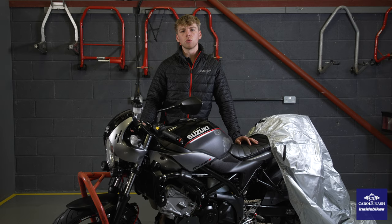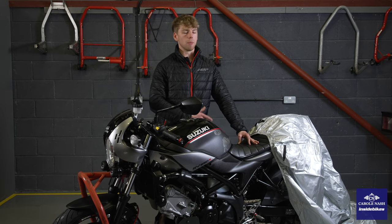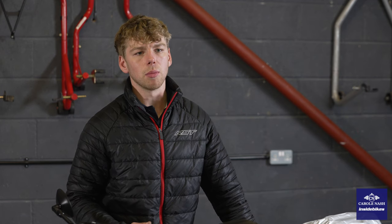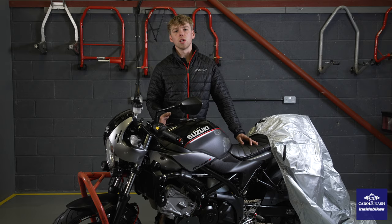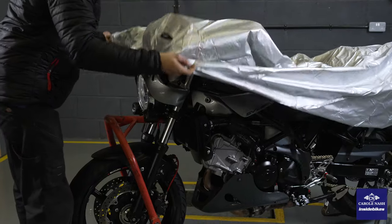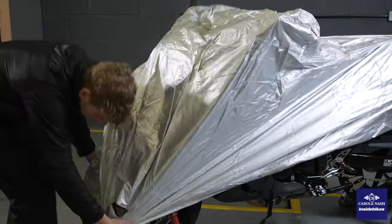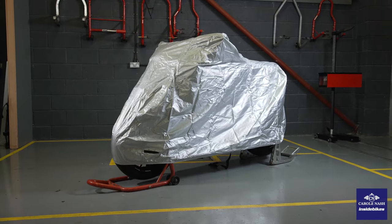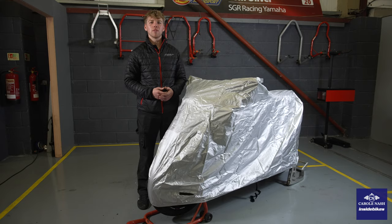The fifth and final step: we're going to brim the petrol tank and put the bike cover over it. The reason we're going to brim the tank is to prevent any rust getting inside the petrol tank over the winter months. If you've got a carbed bike, I would suggest you put some additive in the fuel to prevent it gelling up the carbs and blocking them — or the other alternative is just starting it up every couple of weeks, making sure that fresh fuel is kept in the carbs. That's my top five tips on how to keep your bike stored over the winter months so that it's ready for the spring.